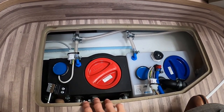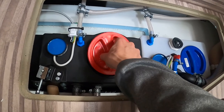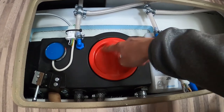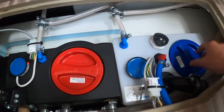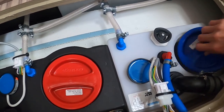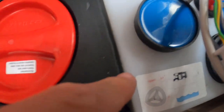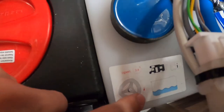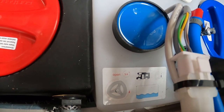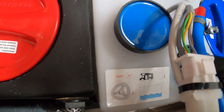In the bedroom, underneath the floor: lift the panel up and you've got access to your waste and fresh tanks, should you want to clean them out after or at the start of every season. You've also got a travel drain — open this three-quarters, open this handle, and it will drain leaving approximately 20 litres in the tank, draining some water off to make the vehicle lighter, which is better on fuel consumption.